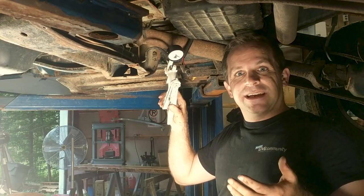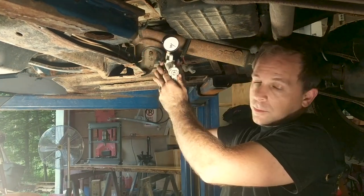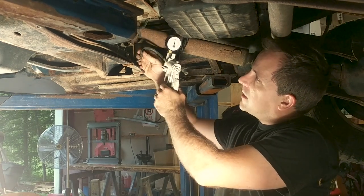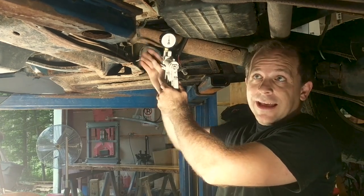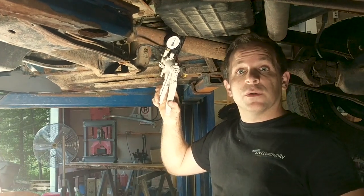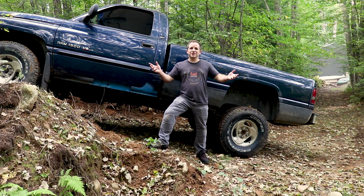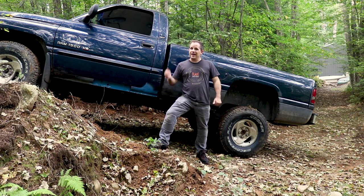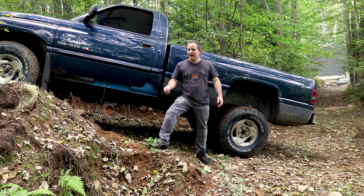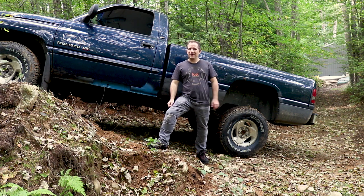The center axle disconnect is run by vacuum from that little valve on the transfer case. I've got a vacuum pump here to put vacuum on the line to see if it's holding, and I found out that my lines were mostly rusted — I had to replace most of it with vacuum tube. I'll replace this with hard line once everything else is fixed. Now that the four-wheel drive is working, we've got some new rubber on there and it's doing fantastic. Hopefully you don't have the same problems that I did. Thanks for keeping up with me — hope to see you in the next one. Have a fantastic day.